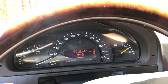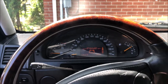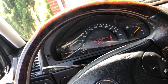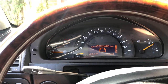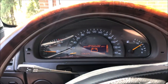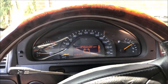I'm just out doing a bit of shopping, what shopping I can under all this stuff in the G-Wagon. It's hot today, 28 Celsius, which is 80-plus with humidity. I turn the air conditioner on and everything seems fine, but I get this under-voltage warning — 'switch consumers off.' When I turn them all off it goes away after a minute. More than likely it's the alternator, voltage regulator, or battery. If you get this little warning on your dash, let's check it out and figure out which one it is.